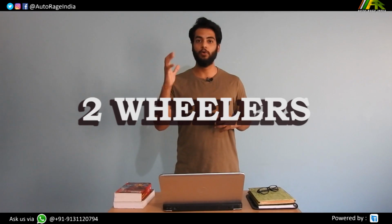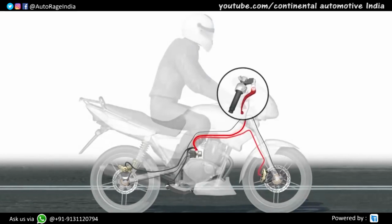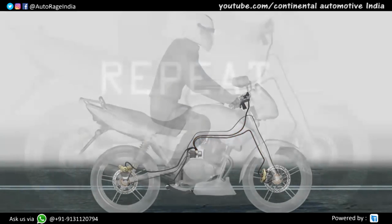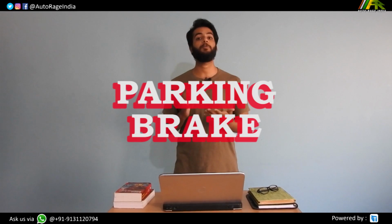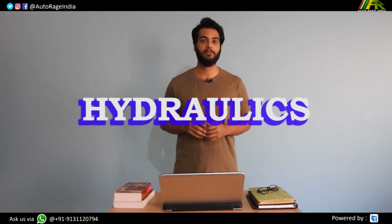If you take a close look at two-wheelers, you can spot two independent braking systems, one for front wheels and another for rear wheels. And they act as fail-safe in case one of them fails. So cars have a fail-safe in the form of parking brakes. Now this system operates independent of your regular foot pedal brakes. Like I told you in the previous video, the regular braking system uses hydraulics. But parking brakes or emergency brakes don't use hydraulics. Instead, they use mechanical links. Let's understand the working of emergency brakes.